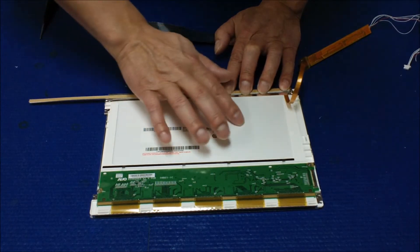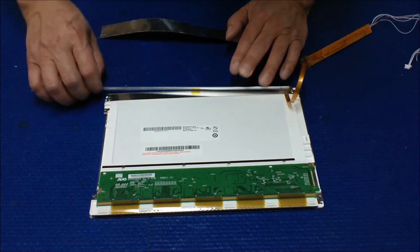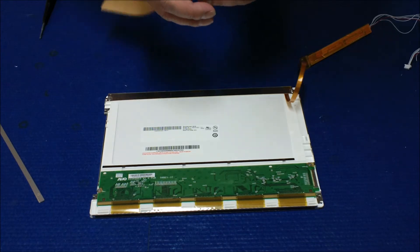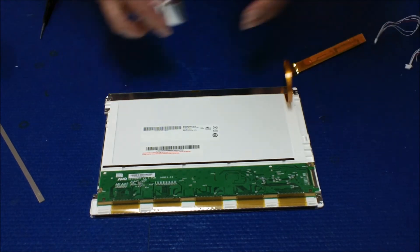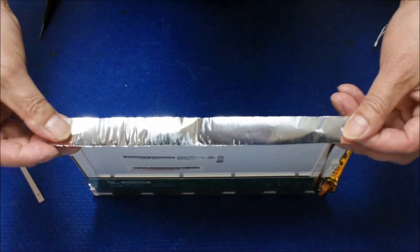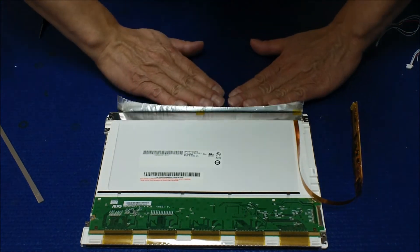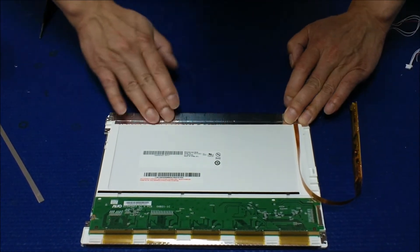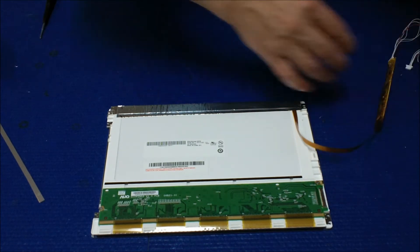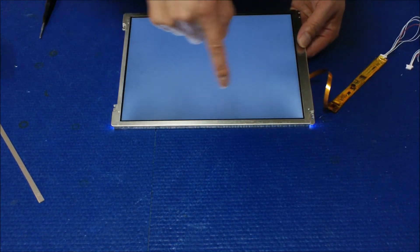Push it like this, make sure this LED strip is straight. Sometimes if you peel off too much it can get a little bent, and you'll see light spots and some dark spots. Let me disconnect this first, then put it back at the edge. Fire it up — see what happens. Much better, right? It is much better.